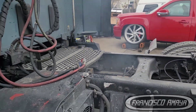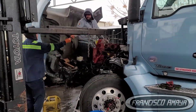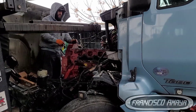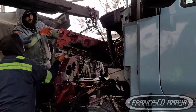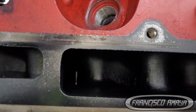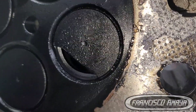The only thing to do is to remove the head. For Cummins ISX it's a little harder because we have to remove the radiator and the front components of the engine to get access to remove the camshaft, and then we can lift the head. Once that's done, we can lift the head pretty easily — just be sure not to grab any other components. Once you get the head out, we can identify the issue, and in this case the cylinder bore is broken.